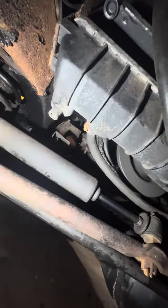The steering dampener was completely loose — tied that in and greased all of the fittings. Also found that the trans cooler line was rubbing on the steering dampener, almost wore a hole in it. Moved it out of the way.